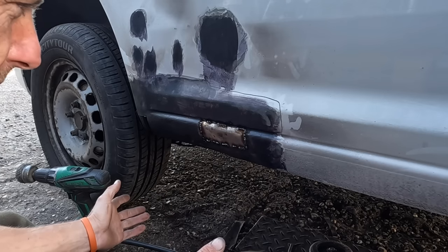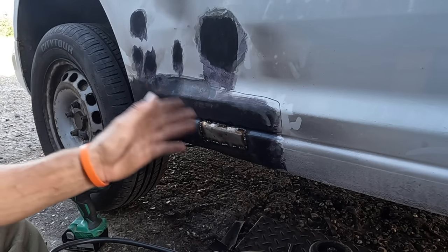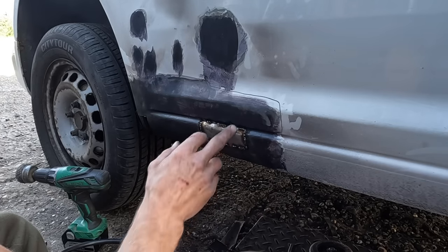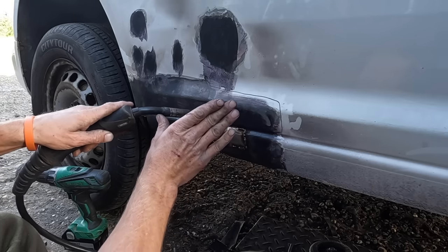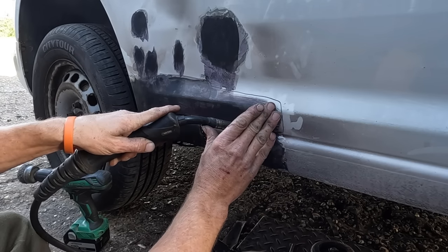And this is spot welding. It's literally as it says on the tin. It's not pretty, it's not going to look like the welds on a push bike. We're spot welding because if you just welded a slug around that, it's going to distort out of shape badly. So I weld a few tacks in and then I go round and I join the tacks up, let it cool down a bit, couple of tacks, let it join up, and literally just a little.